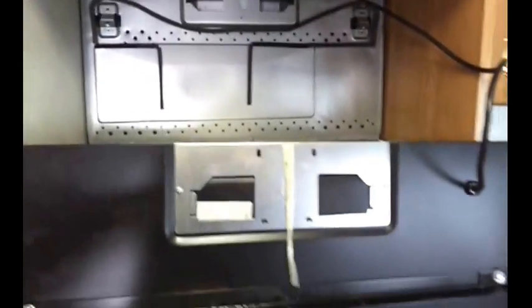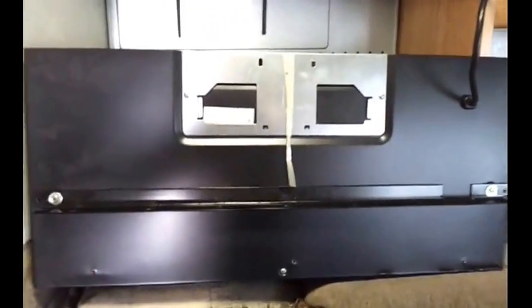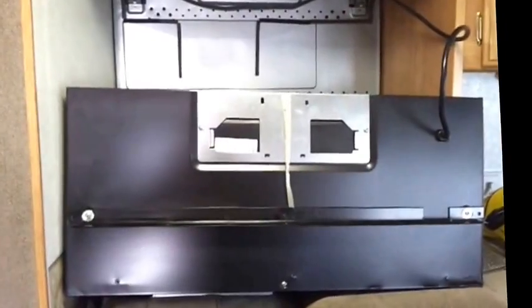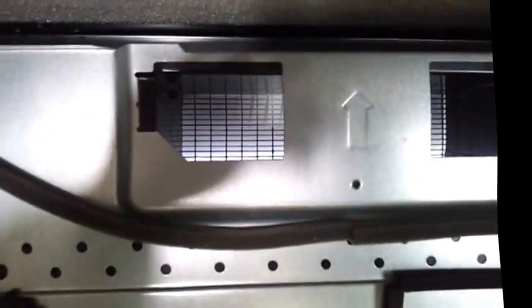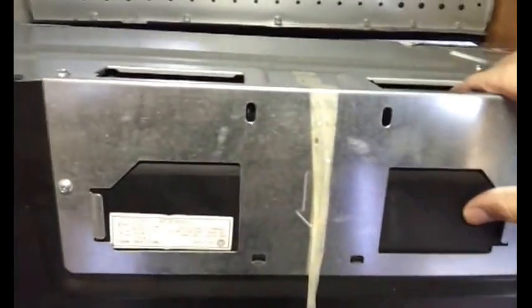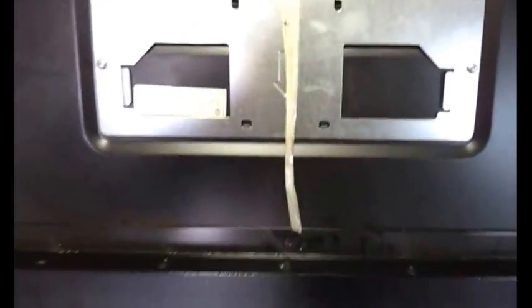The whole reason why I took this thing down is I noticed ever since we had the RV, when we turn on the vent it always blew air straight at us — it didn't blow air outside. Even though you look right here in that little hole, you can kind of see some light. That's the flat flapper vent on the side of the RV. When we turn the vent on, it never blew air out that vent — it always blew it right back inside the RV. I knew something wasn't right. Why would they put the vent there if it's not being used? So for the investigation, I've seen the way they've installed this — it looks like it's all blocked by these plastic pieces. So I'm going to take this apart and see if I can get it fixed to where it will blow outside. I guess from the factory they got in a hurry that day and didn't hook it up right.